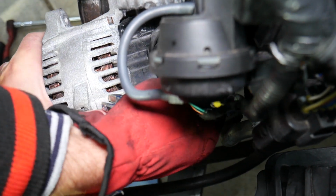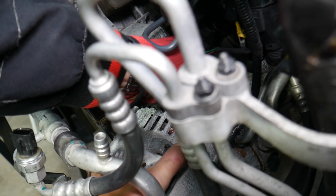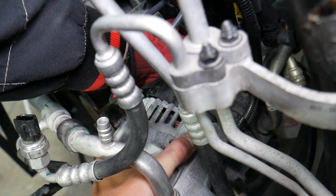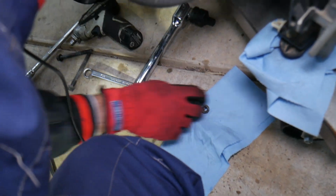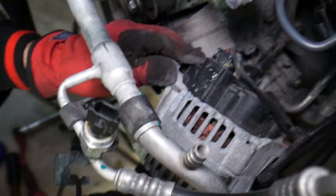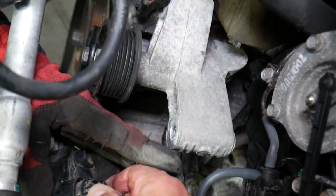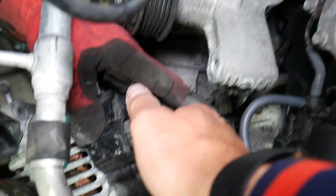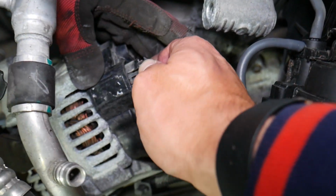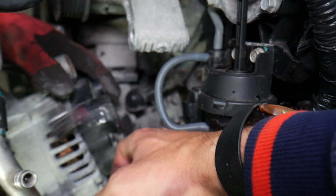Okay, almost out. That's why you have to have the battery disconnected, because once you remove that wire, if you attach it to negative ground, something with a wrench or something, you're going to short things out, and that can, guys, cause quite a bit of trouble. Nut is right here, actually it came on where it's supposed to be. Now we need to just disconnect. Let me grab this one now. This is the one right here. Press down and release it, guys. This thing right here, press down and release it. It has a seal inside that prevents it from coming loose.